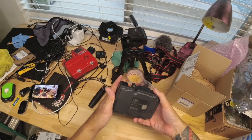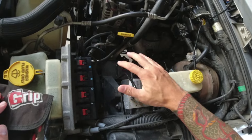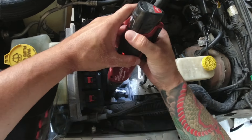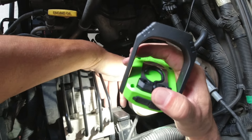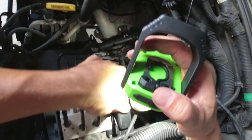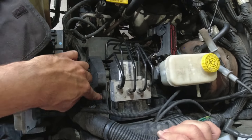This will require programming, which I'm going to show you in a bit. The module is right here — I'm going to need to get this loose. We don't have to take apart any brake lines. You're going to have a 10-millimeter here. The connector for the harness has a little clip you have to unclip and then pull up to unlock the connector.